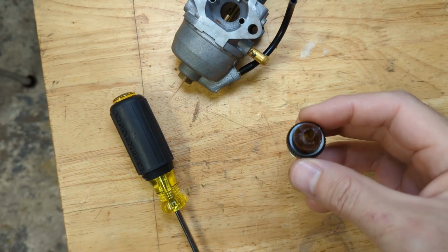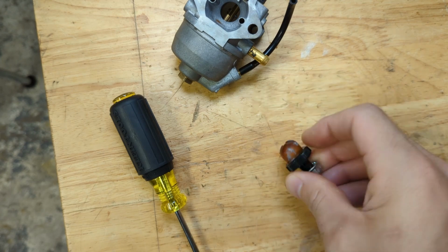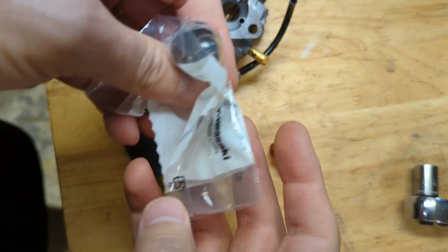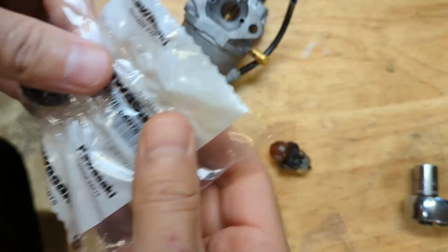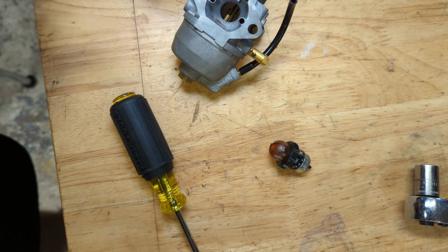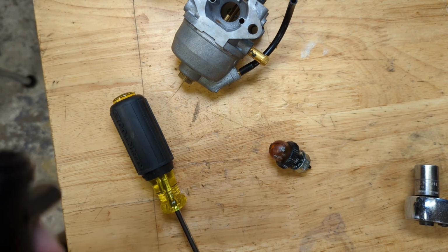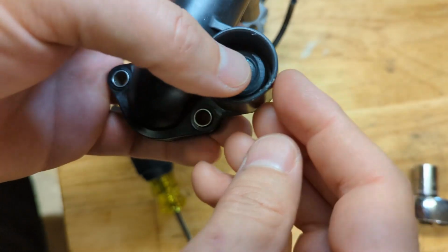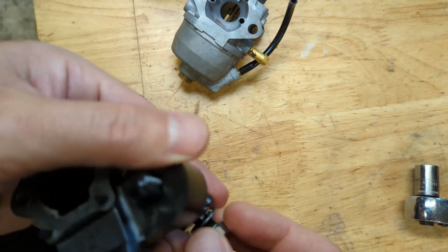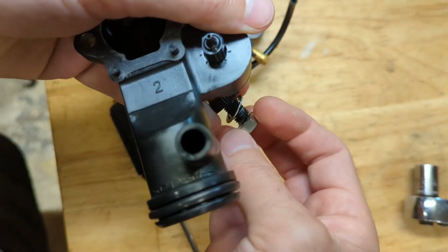So here's the old purge bulb assembly. You can see it's pretty demolished. Got a new one from Kawasaki here. I'll leave a link in the description. It's not a cheap part as I recall it, but what OEM part is. So then this just slips in there. And again, this acts as a substitute for the choke, because this carburetor has no choke.